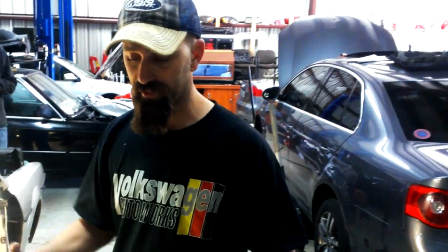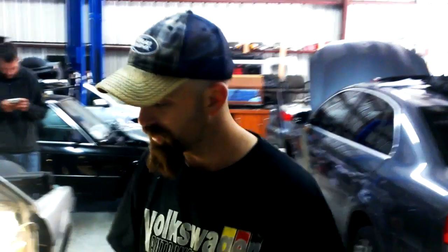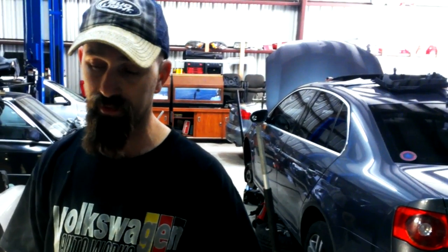As far as the suspension height goes, we raised the unibody floor about 1.25 inches higher into the Scirocco than it was on the TT. We wanted to do that because we wanted the car to sit lower, but we didn't want to just lower the suspension. I'm tired of seeing all these kids with Volkswagens and Hondas and every other car, and they lower it and then go, oh, I fixed it, I got camber plates. Well, it doesn't really work that well. So our plan was to actually lower the entire unibody further in, or recess it further into the car, so we can have the car lower to the ground and still have full suspension travel, so we can actually drive our car every day without bottoming out and hitting everything.